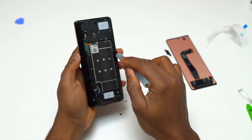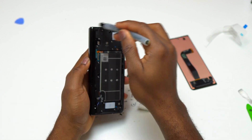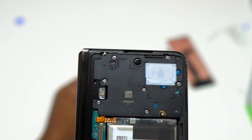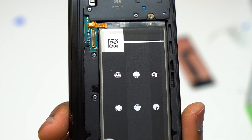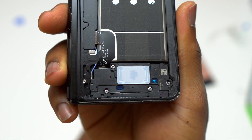It is extremely important to clean the area where you're going to install the new screen, because if you do not do this it might impact the longevity of your screen and you might even have the screen getting separated from the body of the device after a few months. I have cleaned everything out of the outer screen area and it is pretty clean now — there is nothing left on the area where the new screen is going to sit.